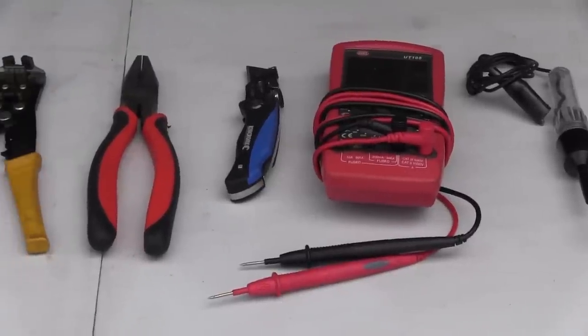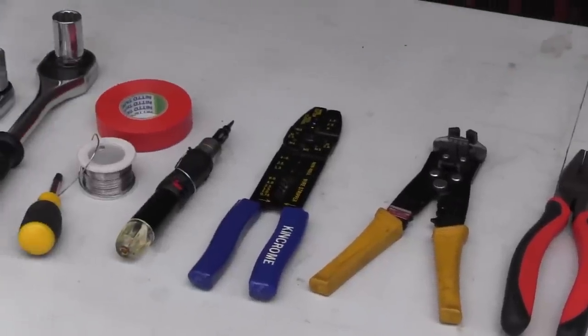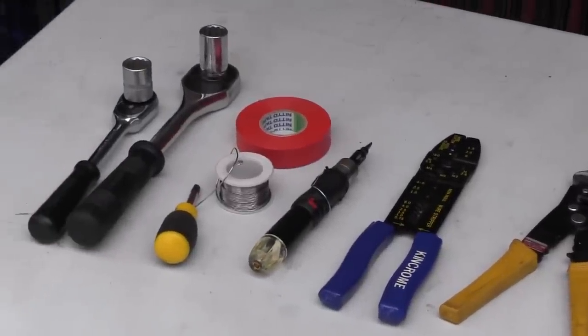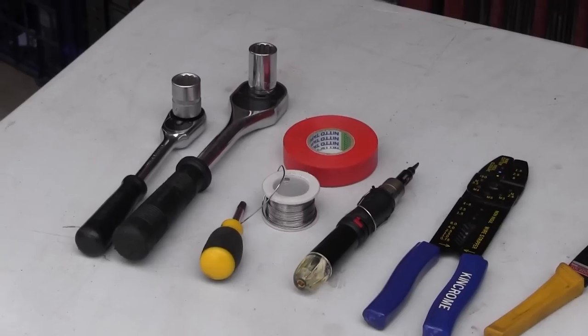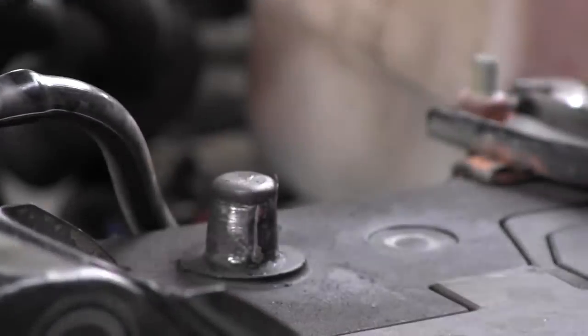To complete the installation, you'll need a few basic tools such as a pair of pliers, side cutters, a crimper, a test lighter or multimeter, some electrical tape and a couple of 17mm sockets. Start by disconnecting your battery and then laying out the wiring loom.